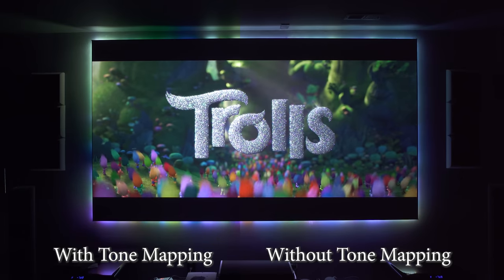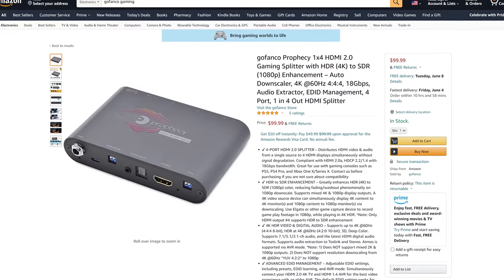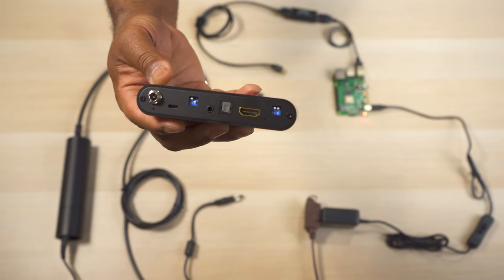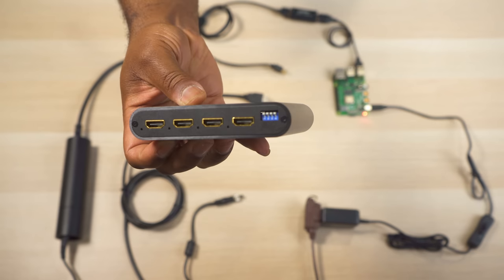The better option is to buy a cheap HDMI to USB capture device and a separate HDMI splitter. Some cheaper splitters do support 4K HDR, but the problem is the second HDMI output will have washed-out colors during HDR playback — meaning your Ambilight LEDs will lack color and won't match the screen. The best option I've found is the GoFanCo Prophecy Gaming HDMI splitter, which costs about $100. It sends full HDR to your TV and does HDR to SDR tone mapping on the second HDMI output — exactly what we need. The only downside is it doesn't support HDMI CEC, which will break automatic device control via your TV remote.